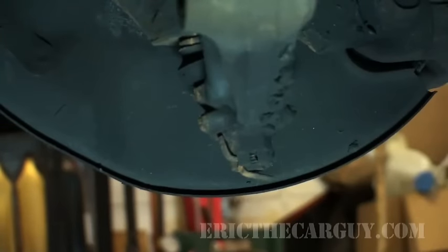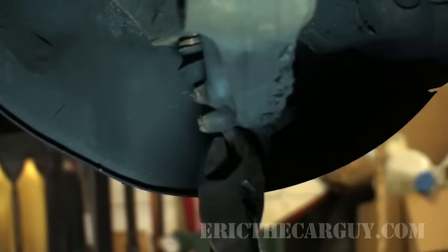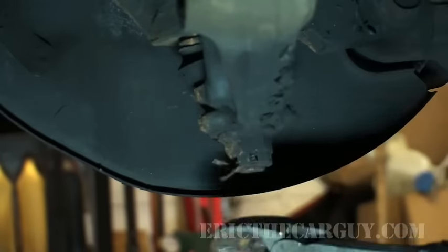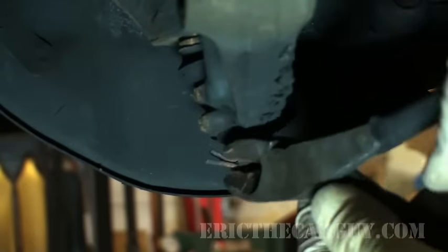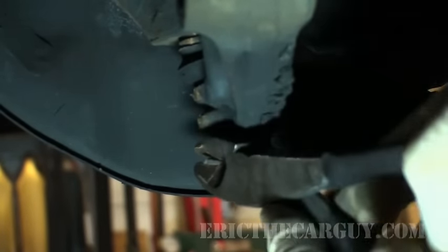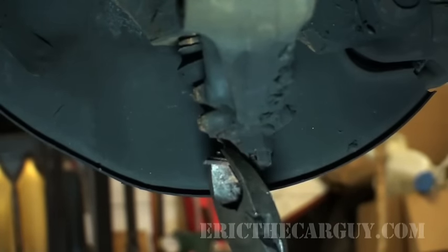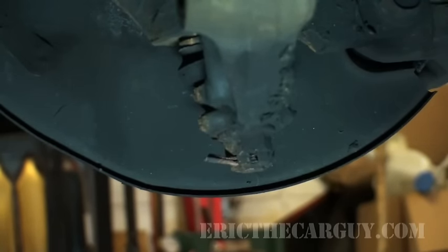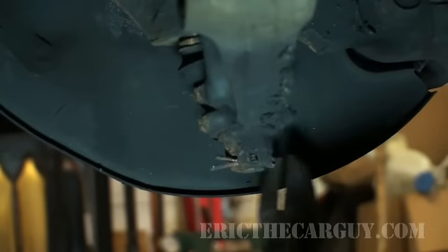Next, we're getting under it. Now it's time to get the lower ball joint loose, and for that we need to first remove the cotter pin. If you're having trouble with cotter pins, you can do what many do — just cut off the end and then spin the nut right over the top of it. If you're in an extreme situation, you can do that. Personally, if I can get away without doing that, I won't — I just like to not get them jammed up in there.